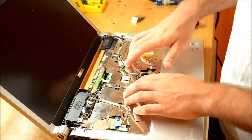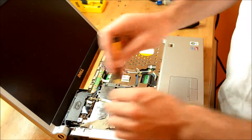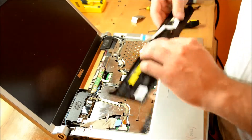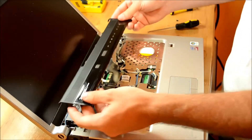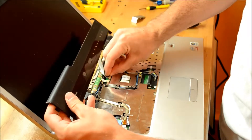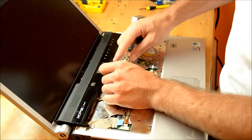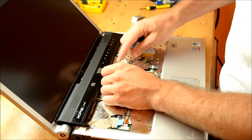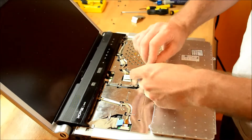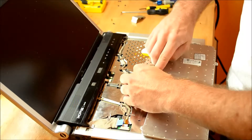Now that you've got everything wired, there are a couple things you're going to want to do. Put your last small screw up here. Then take this piece — remember that this is your top piece. You're going to want to wire it in and press the connections down. Then take your keyboard, put it face down, fold this around — it should sit in there pretty easily — and then press the connector down.